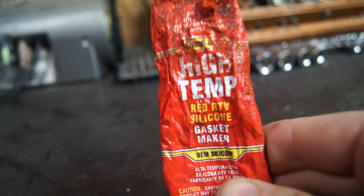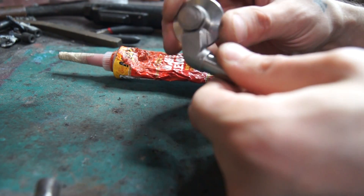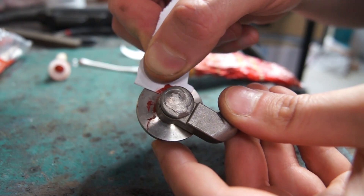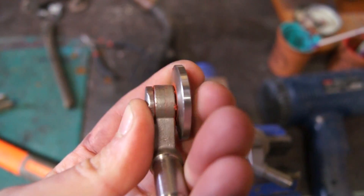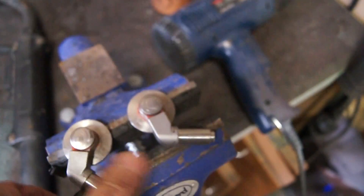I'm thinking that if I put silicone in and around all these gaps, it'll just stop it rattling while still allowing the silicone to flex — still allowing it to move and seat perfectly. There's no risk if it comes off because it'll just blow up the exhaust. Everything still moves and it still rocks, so it'll still make a seal. But the main difference is between the old one and the new one.